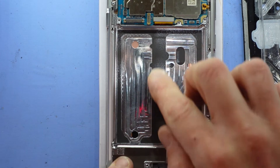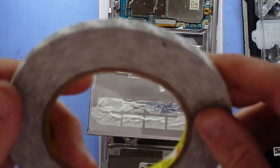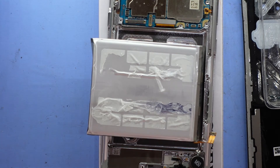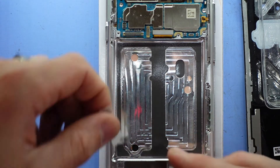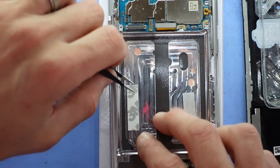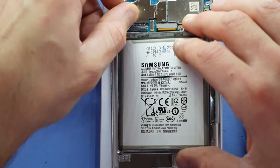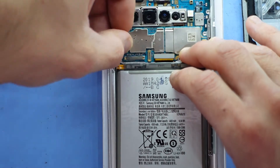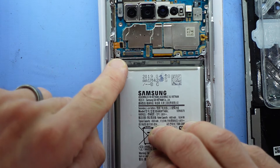Take out the film for the battery down here. There is no adhesive there, so you are going to have to use your own. I'm just using some generic 3M tape — it doesn't have much strength to it, but all it has to do is stop the battery from rocking inside the frame. I'll put the strip here and here, just in case I do need to take it out I can clean up the tape. I'll temporarily connect the battery just so I know the battery flex cable and connector will still match up no matter where I put the battery. So right now there's power connected to the board — push down and then disconnect the battery, and now I know I can get that back on quite easily.